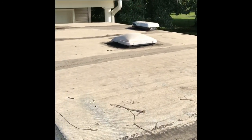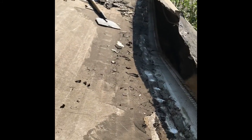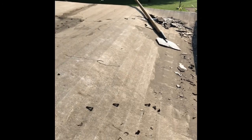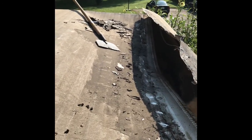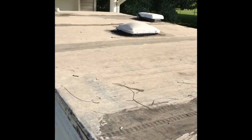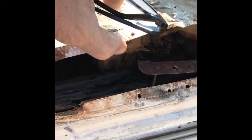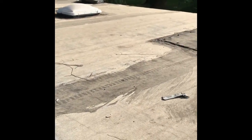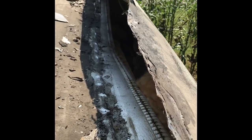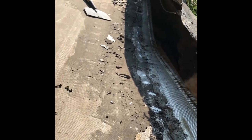I'm going to take this side loose back past the leaking vent. My plan this afternoon is to roll the roof back using some concrete cardboard tube forms to keep it from creasing. My intent is to roll it back, replace that sheet metal, replace the trusses, and repair this damaged section where the wood is rotted. There are no holes in the roof — everything was leaking around the vents and around the front seam, which could have been addressed years ago with some wide sealing tape.